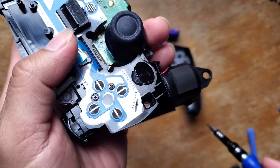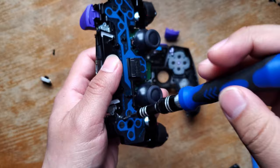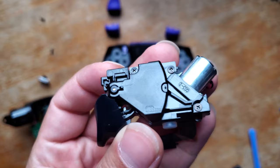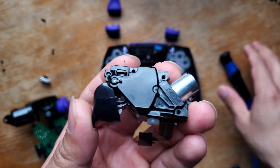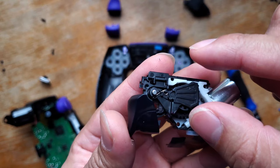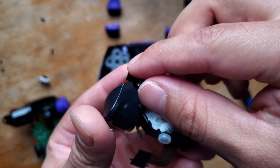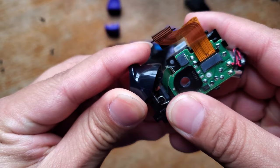First, turn your controller around — you're going to have two screws, just take those out. When you take the screws out, this whole piece is going to come out — this is the adaptive trigger. Next you're going to remove this ribbon cable right here and take out the screw. Three more screws here, here, and here. Once the screws are out, take this part out — just pull it out. Then this one, and then there's a metal rod — pull it out. From there you should be able to take it out, just watch out for the spring.